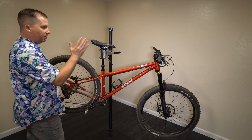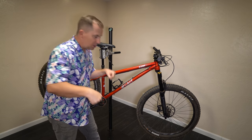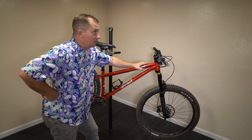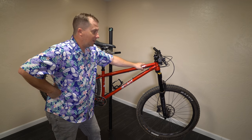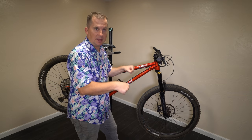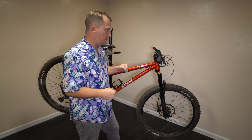There's nothing to compress at the back, so it just pivots as the front squashes. When you hit a drop and the front dips, this bike goes from a 63-degree head angle to a 70.5-degree head angle — that's significant. By swapping to a 130mm fork, the range of motion is less and it stays in that sweet spot more, so you don't feel the geometry changing as much through your ride.